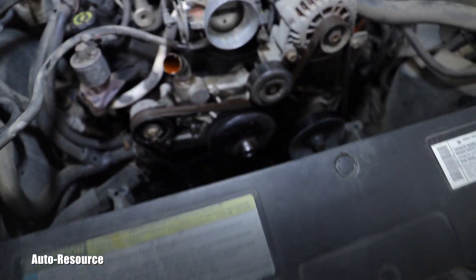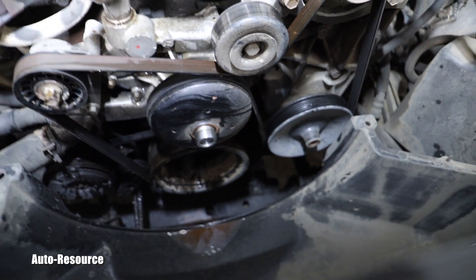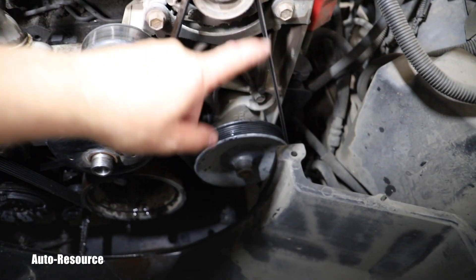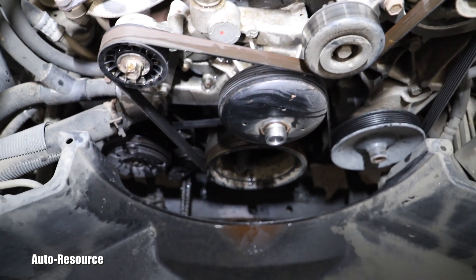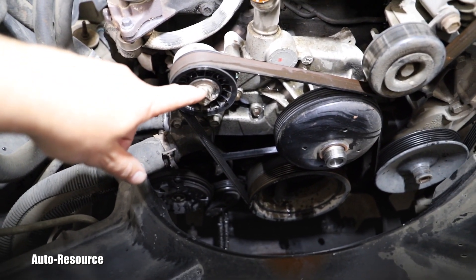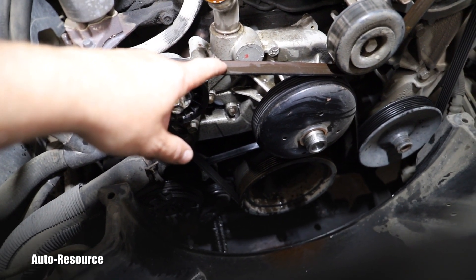Because I like you so much, I will take time and show you this. With the fan removed it's no longer obstructing the view. You can see how the belt is routed because we are going to remove it. We need to remember how it's routed — but it's also shown right here on the diagram, so you don't really have to freak out if you forgot.